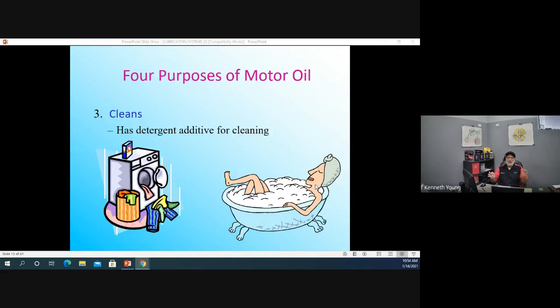The base components of the oil, that really doesn't go bad. What goes bad is all of the additives in the oil. And today's oils can have up to about 30% additives in that oil. So if those additives wear out, it's going to cause some type of problem in your engine. And there's a lot of people driving around and they're not changing the oil as they should. Hey, that brings us up to a really cool question.